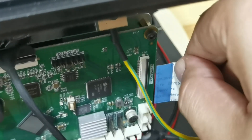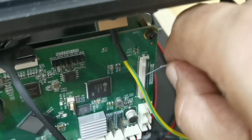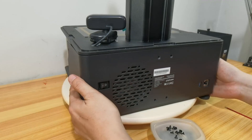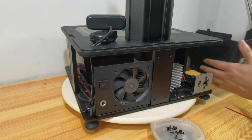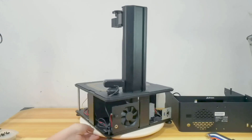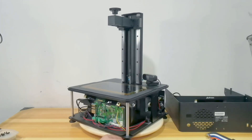For your information about the LCD cable: the metal strip should face the board when you plug it in. Then remove the back casing. I also think it is the right time to do some cleaning, especially with the dusty fan. Let's take our time and admire the beauty of this naked Mighty 8K.